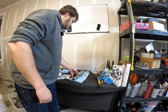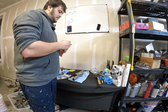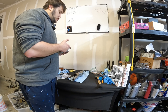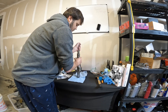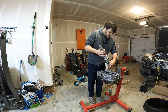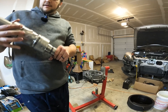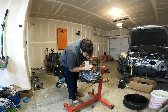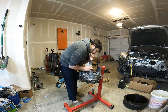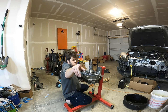I'm a little bummed — my rotor has moved and I have no idea what I'm doing at this point. This is my eccentric shaft — we are reusing it as it's in really good shape. I have watched enough build videos to know: do not build this backwards. This thing's slick — I'm going to drop it in here. It's actually best to install the eccentric shaft gently. Now is a good time to ensure that you have the flywheel end of the eccentric shaft at the back of the engine, otherwise you will have to fully disassemble the entire engine if you install it backward.